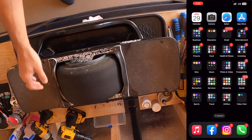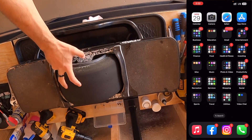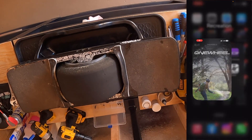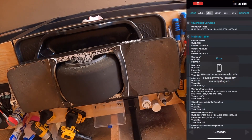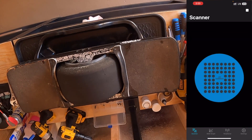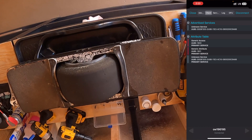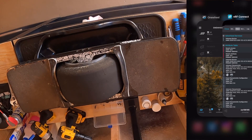The first thing to do is turn on the XR. If you have headlights, those will come on; otherwise you'll feel resistance on the tire. Next, open up the Onewheel app — we're not actually going to connect to the board yet, just open it and then minimize it. With it minimized, go to NRF Connect. Drag down to refresh and you should see your board listed. Make sure you know your serial number before proceeding so you don't accidentally tap into somebody else's board. Connect to the board you want to calibrate.